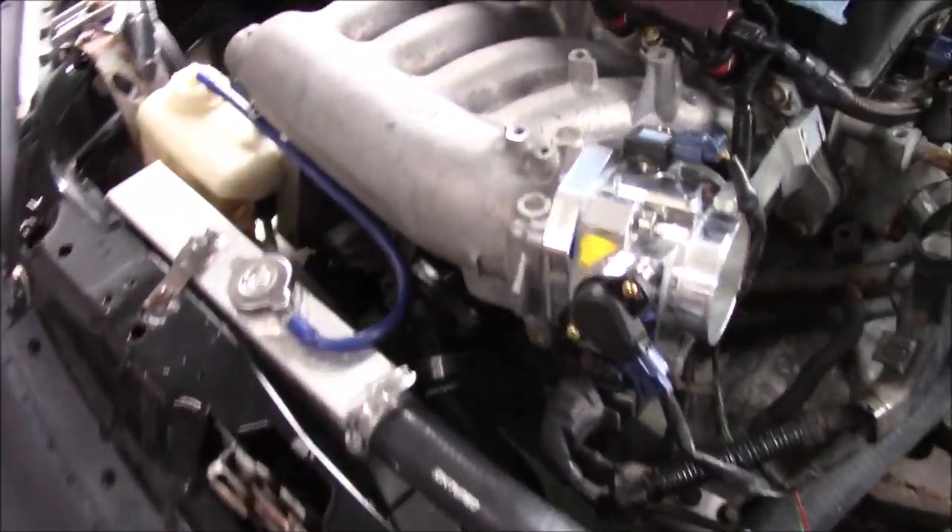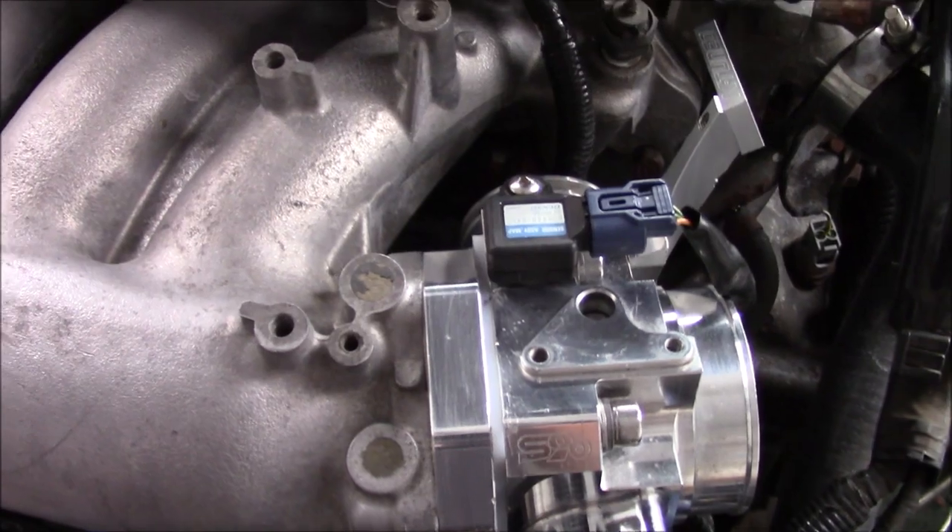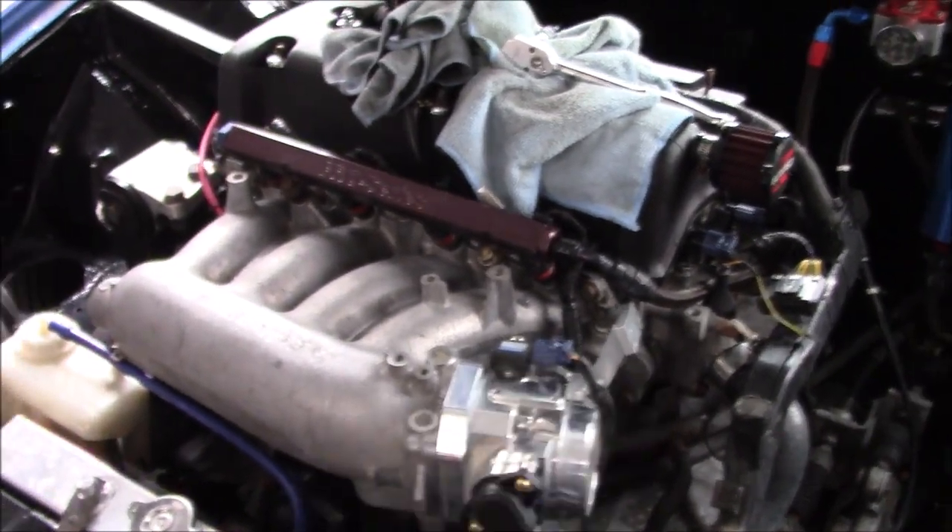Here's the throttle body — everything's all polished up. I gave it another hand polish and it looks a lot better. So I ended up putting the bracket on the bandsaw and chopped that section out — it actually came out pretty good, I was happy with that. But now mocking it up, I'm realizing this bracket wasn't going to work anyway, because this bracket is meant for stock throttle bodies. Now that I'm looking at it, the angle of where the throttle cable goes to the butterfly is way off. Now that it fits better, it's not going to work.